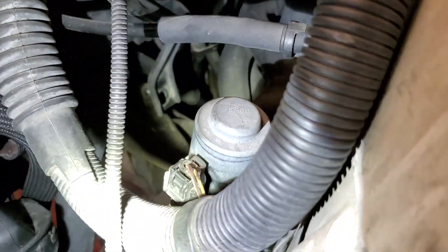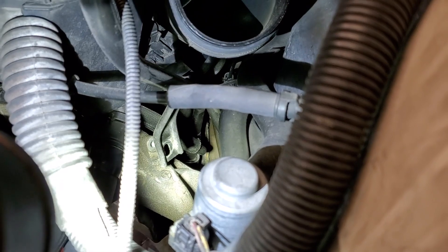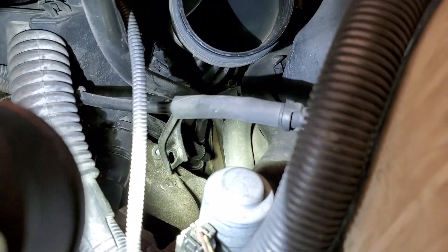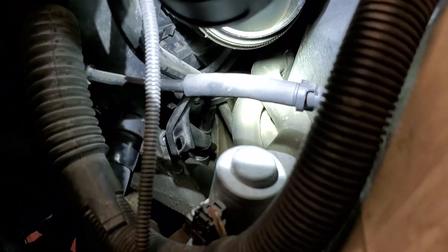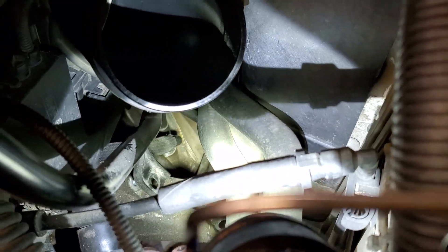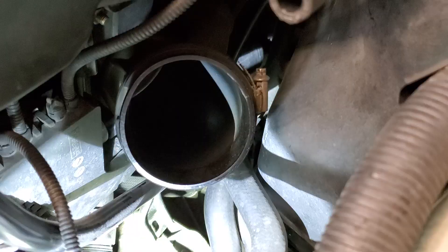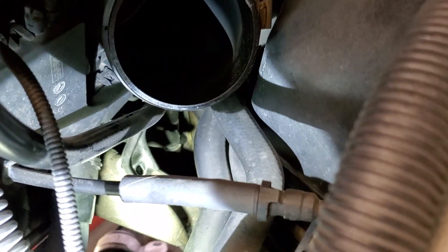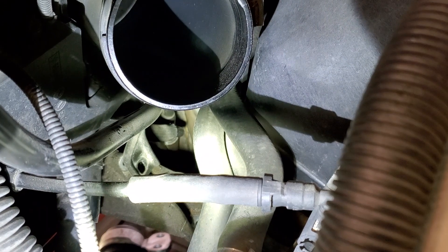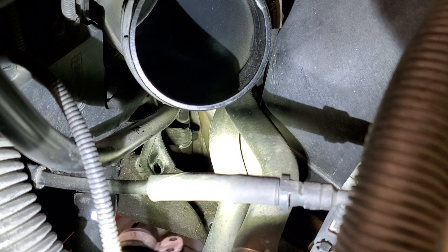What you're really after is down here. That mess right down there — you can see it loose — that's the bracket that holds the dipstick tube into the oil pan, which is way down there. If you can see that braided hose there, that goes into the oil dipstick tube, and that goes down into the oil pan. That's one of the things you definitely have to take off. Where that dipstick tube goes down to the oil pan, there's an O-ring that seals the tube to the pan.